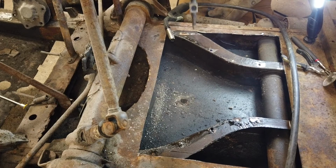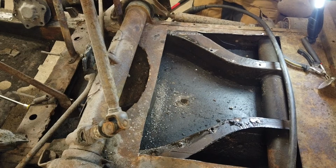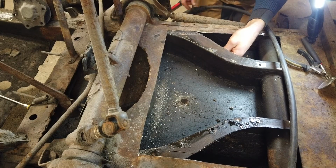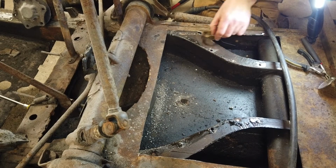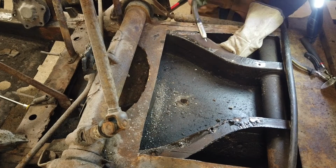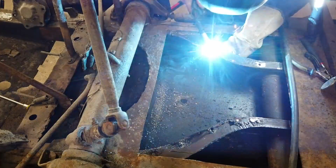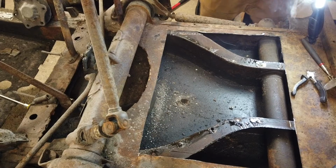This is some thin stuff. And for the holes up here, I'm going to use a big brass nut and put that under the hole, because that won't be possible to weld to, but I will be able to make a pool of the molten metal on top of it and then close up the gap, I hope. And then I'm going to try to clean it all up.